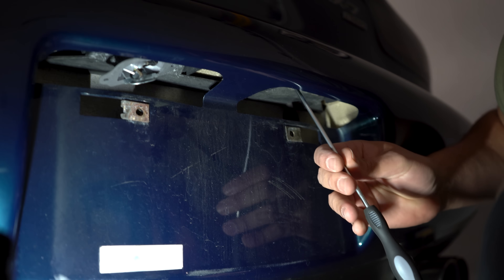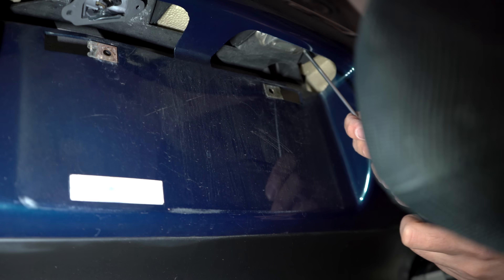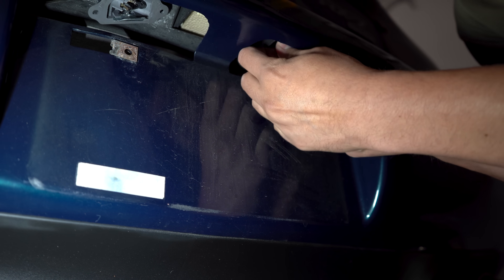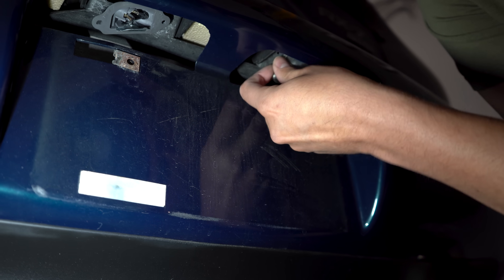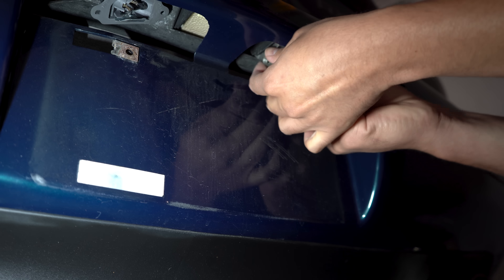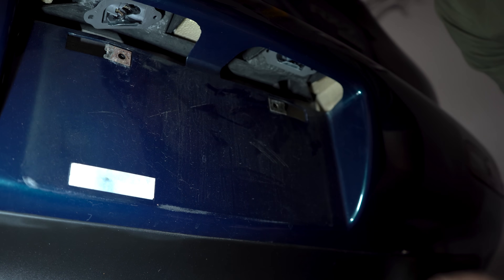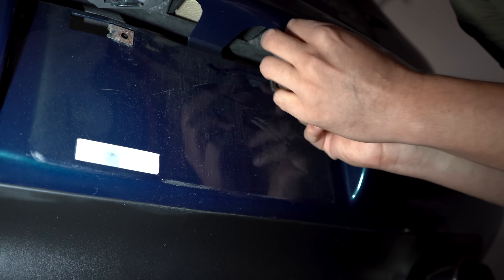I've got a Phillips here — there are two little Phillips screws and I'm going to take them off. I'm going to try to separate the lens from the actual housing by putting my fingernail in there and breaking that little artificial seal. I separated the lens and then I'm going to do the other one. We got the lens out and we could pop this one down — we're not going to take it out, just pop it down — and then we're going to remove the bulb.